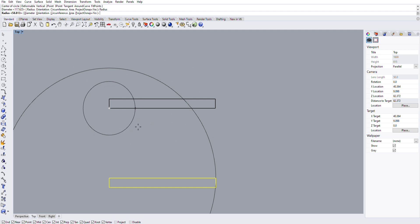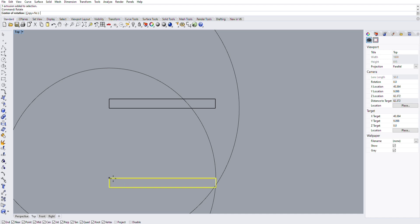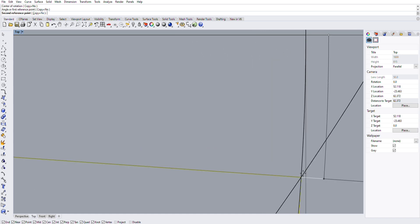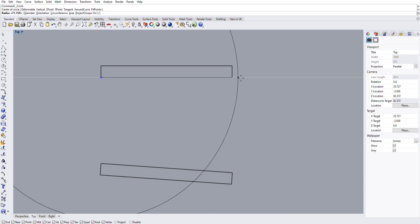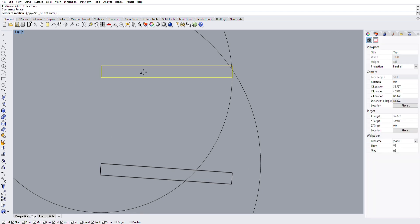I'm creating two circles using radius. I can use my diagonal measurements — from that point I need 71 and 3/4 inches, and the second circle's radius equals the length of the piece we're working on. Knowing that, if we rotate this rectangle from the front point down to where the two lines intersect, that piece is already right — a triangle only needs three controlled points. I repeat this on the other side: first circle radius set to the piece length, second radius set to 71 and 5/16, then rotate the passenger side rocker out until it lines up.